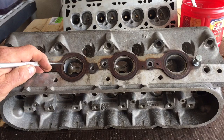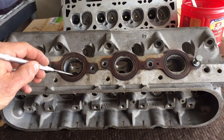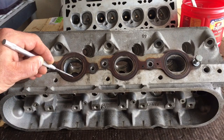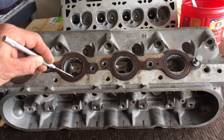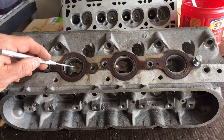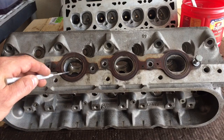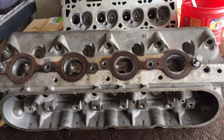A lot of people will slightly widen the exhaust port and raise it to the inside diameter of the top of the exhaust gasket. That's a good modification, because by raising the roof of the exhaust port, you will increase flow-through efficiency, because of where the hot exhaust gases are trying to go to begin with.